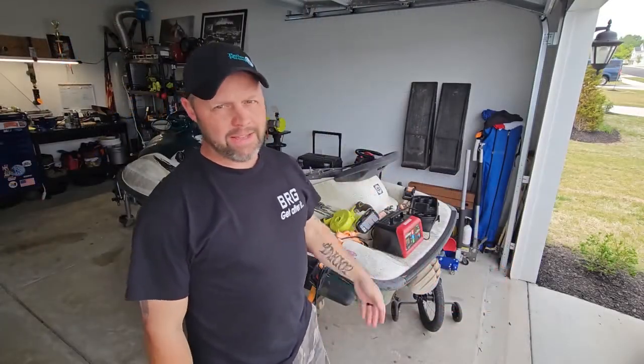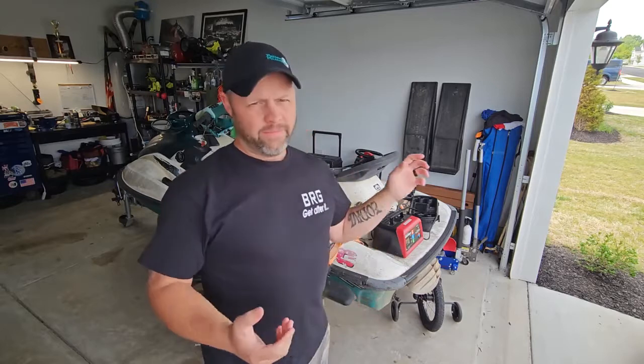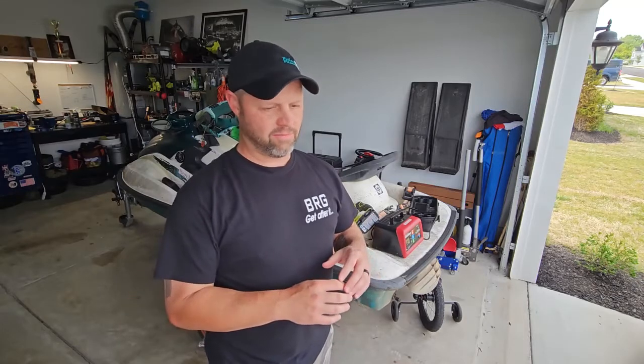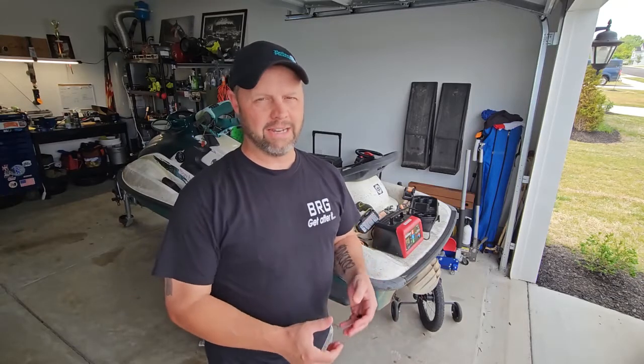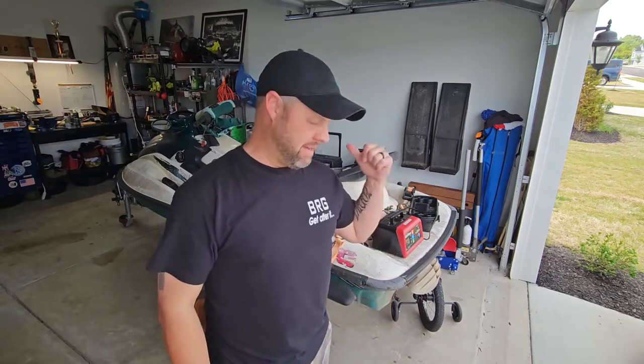Another week has gone by. Stuff happens, busy. I hurt my back, so I haven't really been too active with this thing. But basically, I took the carburetors apart just enough to clean everything out and then put them back together. I did not replace every spring or everything like that. I just cleaned up what looked bad, put new gaskets in, and put them back together. I put them back on earlier today. Like I said, my back hurt, so it kind of took a while.